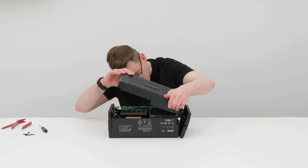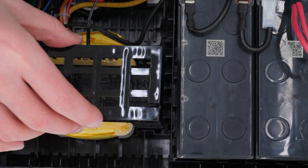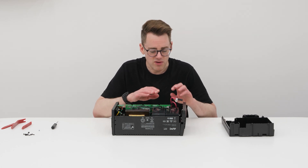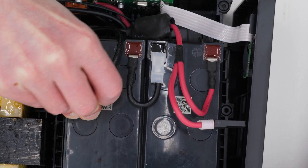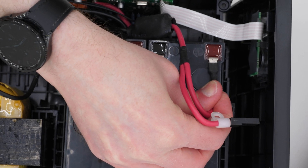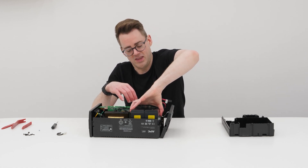This part is connected — we have a screw connection — so be careful when you do that. You might find it easier at this point to remove the screw connection in here. I'm just going to take this plastic piece off the transformer and put it back into the other side of the case; that's just in case there was a bigger transformer in there and the case is generic. There are various systems in here — we only really care about the batteries. To remove those, you just have to pull the connectors off, give them a bit of a wiggle. The middle section comes off, and then a red one. Then the battery can just be removed. This is actually two different batteries, but they've been stuck together with some tape.